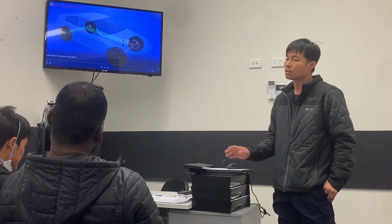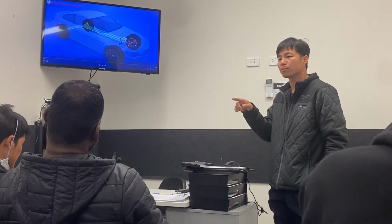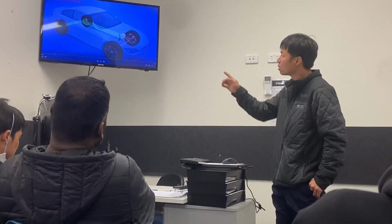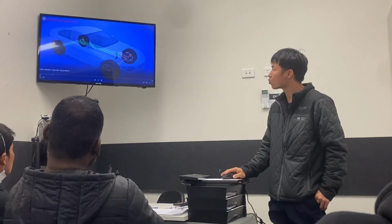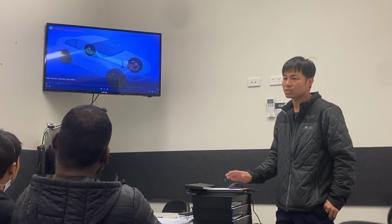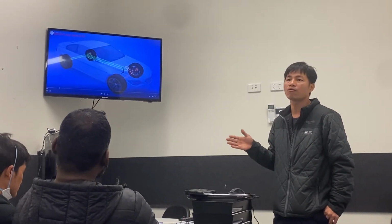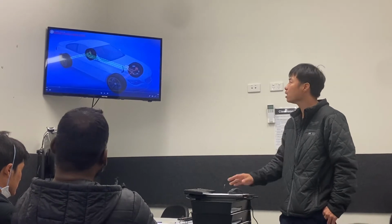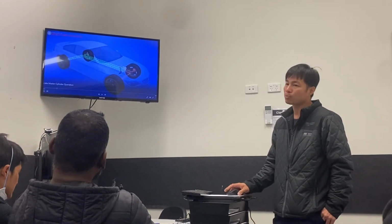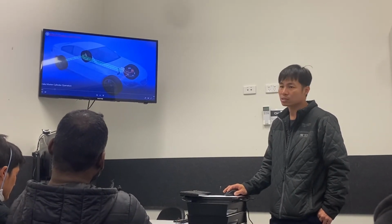That is why the master cylinder has a primary chamber and a secondary chamber, just because our system has been split. In this one, you can see the green is rear, the front is red. It's been split into two sections. That's what we call a front-rear split system. Why is that? If we say the green one is the primary system, the secondary is the red system.